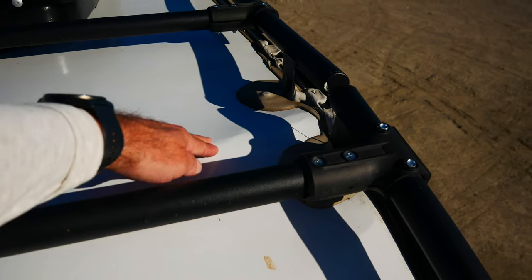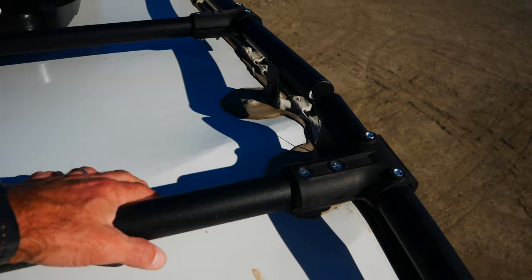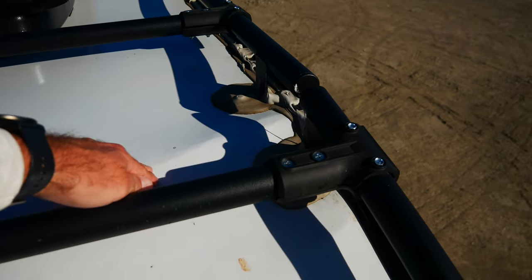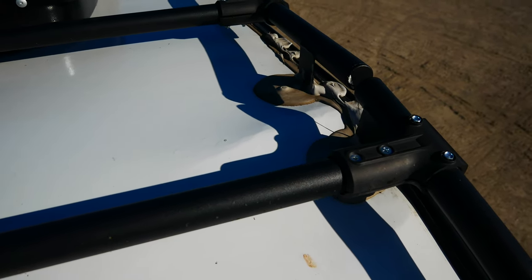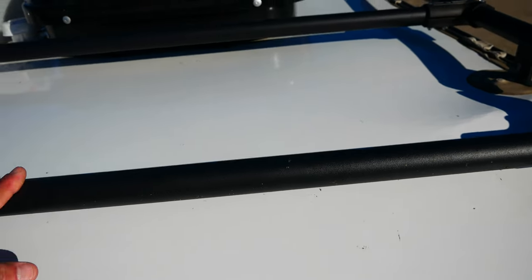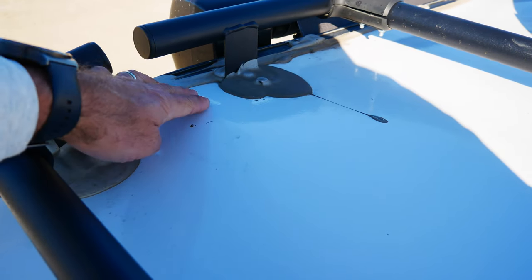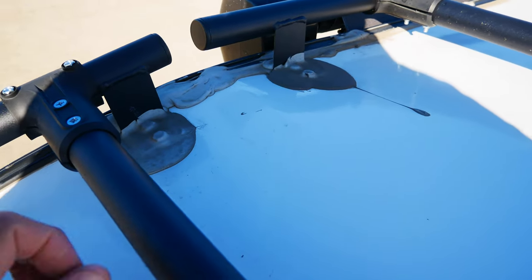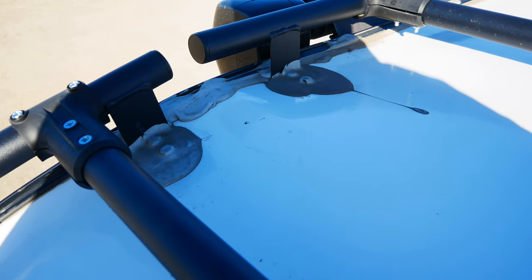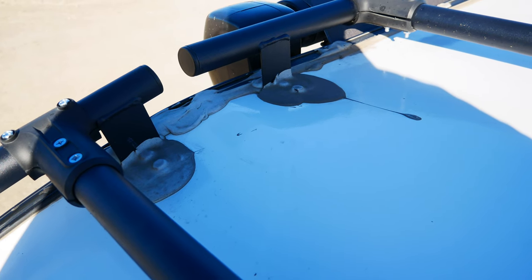So the problem area is those creases right here. You can see the cracks underneath. That's where they mounted that exoskeleton. To me, that's a very concerning area, because right now it's okay, but in the long term, I hope it will not cause any problems. And the same thing is here on the other side. Let me show you this. So basically you can see these cracks all around, and underneath this, the main shell is actually peeking through there. So that's something to pay attention to, because most of those trailers do have those creases, or cracks, however you want to call it.